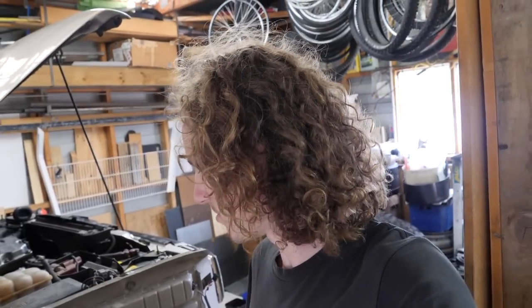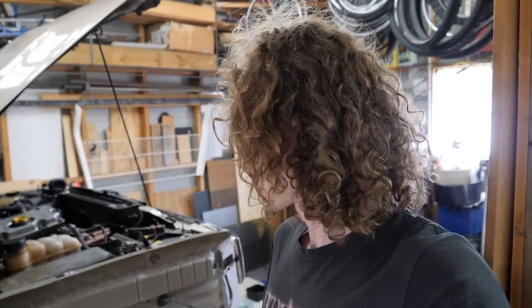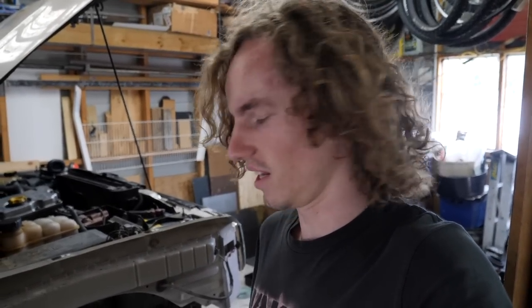Far out, I must say. Yes, I'm a sucker for a Disco 1. Obviously, I've had like, I don't know, 5 or 6 or 7 of them, but man, Disco 2s are so much nicer to work on. They're just so much better laid out. Like, it takes a couple people, realistically, if you've got seized shocks on the Disco 1. Thus, these just cruised on out. It's probably 5 minutes to undo both sides. So yeah, definitely nicer to work on. Anyway, let's drop this axle down and get these springs out.